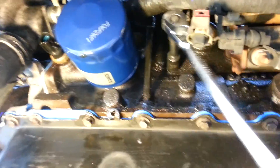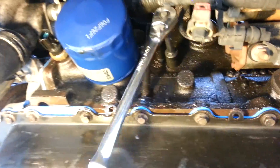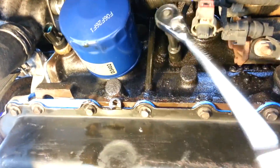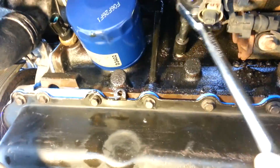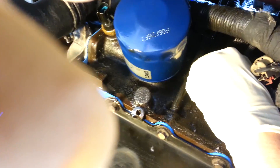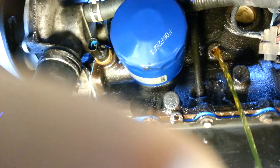Working a ratchet with one hand while holding a phone with the other makes for some sloppiness. This may not drain at all because I kind of sucked out some of the fluid while I was doing the timing cover. But there is proof that there is indeed a water jacket drain plug on these engines. There it goes - it's all over the place, of course. It's draining out.